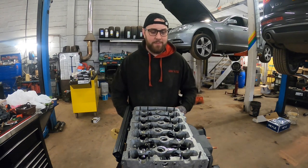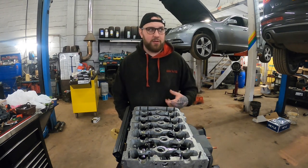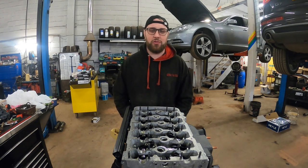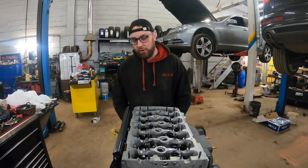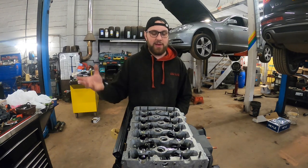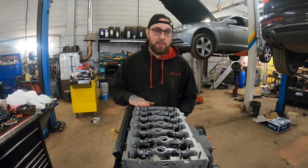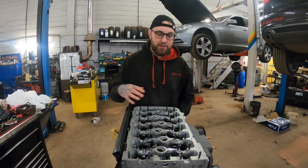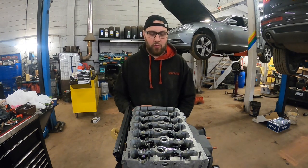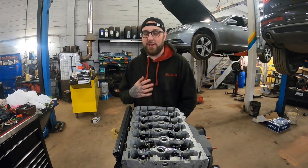He said you can just get the long valves, but I figured if I'm changing valves I might as well do them all. Volkswagen prices were ridiculous, so I got TRW ones - TRW is a German company, they come original on loads of BMWs and other stuff, they're top quality. I ordered a full set of 24 new valves - OE spec, not upgraded, just TRW OE valves. He lapped them all in by hand; he has a machine but went the extra mile for what I'm doing.